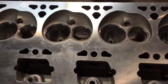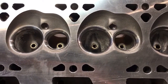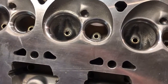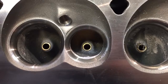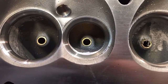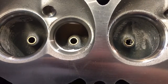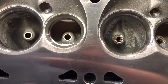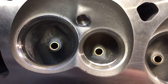There was a 65 thousandths ridge left pretty much almost all the way around the intake seat to the bowl — no cut, no transition. The exhaust, I don't know what those people were thinking. Here's one I haven't finished cutting out — I cut the short side but not the back side. Look at how thick that ridge is below the bowl seat. I measured them out at 135 thousandths ridge all the way around on the exhaust, and that little peak is way more than 135 thousandths. You can see that's solid aluminum that sticks out below the seat.